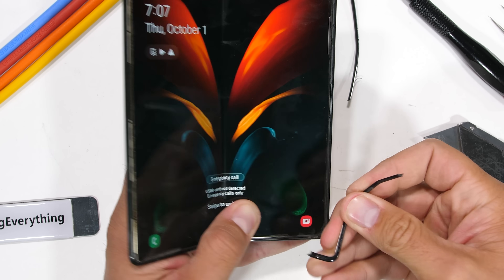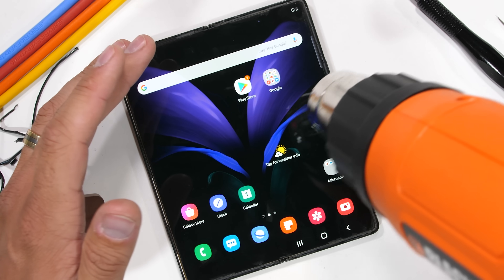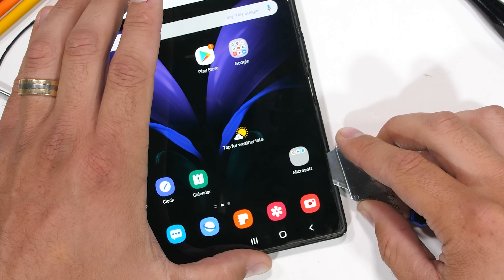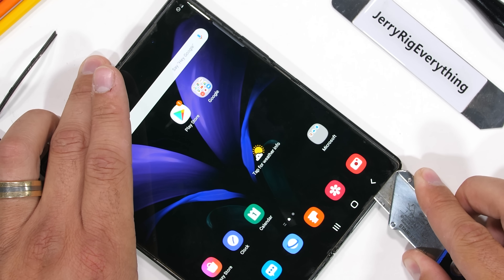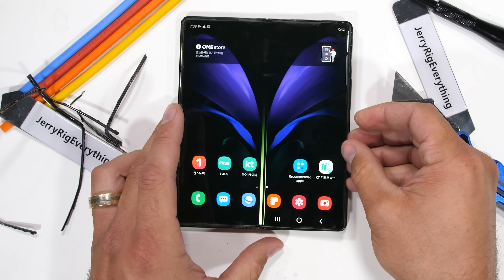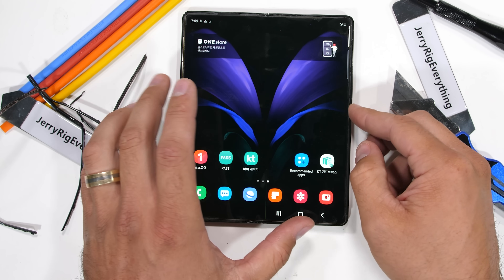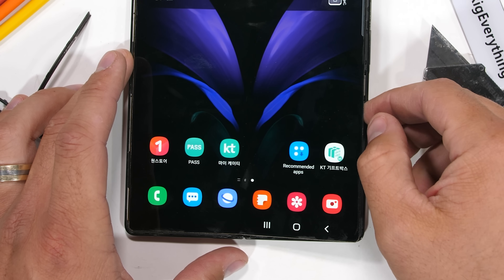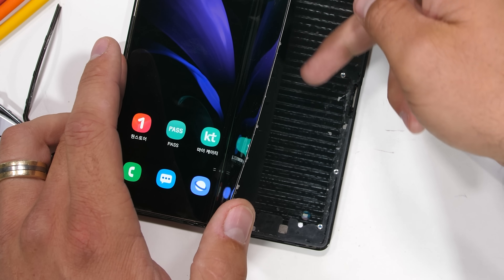The screen is still alive at this point — so far so good. If it's anything like last year's Fold 1, we know that there is a bunch of adhesive underneath. So we'll warm that up with the heat gun, and then I'll use my razor blade to lift up on the metal plates supporting each half. You'll notice that if my razor is underneath that metal plate, nothing happens. But if my razor accidentally goes through the plastic layers into the screen, the pixels instantly die. So we'll avoid stabbing the pixels. Everything stays pretty much intact until we start lifting up the half of the screen that's unglued. The center spine of the Z Fold has started to freak out a bit — this is definitely not indicative of a potential flaw or overly fragile device. Removing that plastic edge piece is like removing an arm or a leg; it's a very vital piece of the screen, and I'm already impressed with how long it's lasted without it.